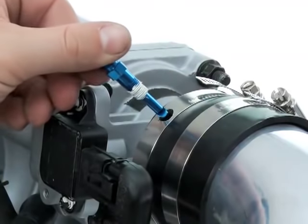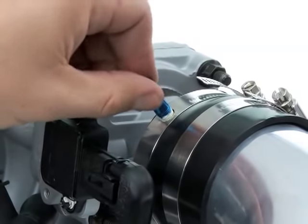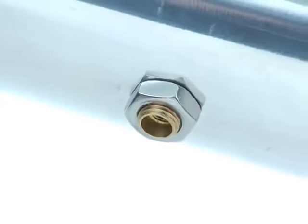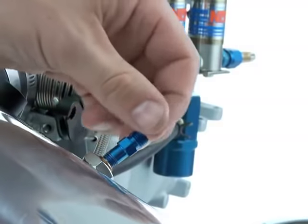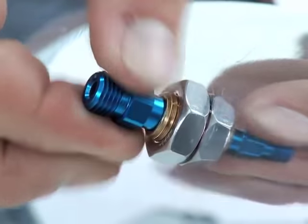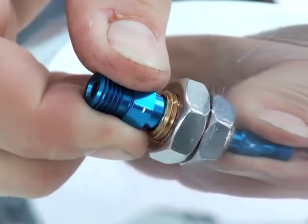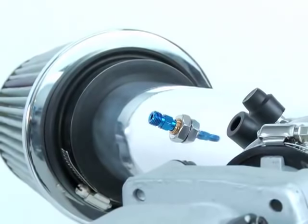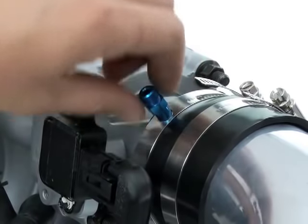With a thin, even amount of sealant on the threads, spin the nozzle into either the threads you created in the throttle body or the mounting collar that you installed in your intake duct or tube. Don't let the nozzle bottom out in the threads. When spinning the nozzle in by hand, if it seats and stops turning, just spin the nozzle slightly backwards until the mark that you made on the nozzle points directly towards the throttle body of the engine. The nozzle should feel secure, but remember the Teflon paste needs a bit of time to solidify.